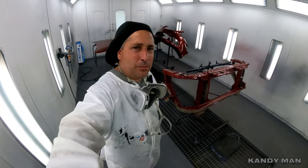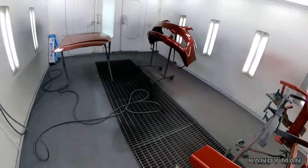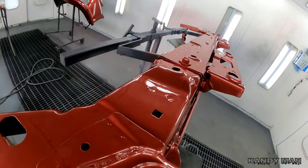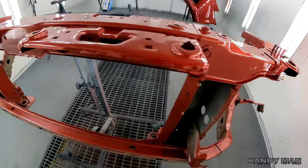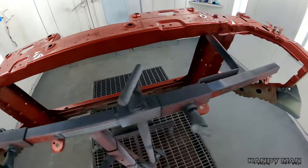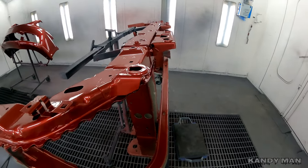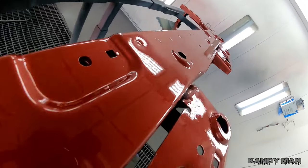All right, guys, so we went ahead and put a medium coat of clear on this, and you guys can see it's shiny. When we cleared those parts over there, we put one coat on this. Now you let this set up a little bit, and I'm gonna dust this now over this, even though it's shiny, and we'll get a nice matte finish from it. That way it's treated and it's got something on it, protection in case somebody uses a chemical on this to clean it later when they're working on this. You guys know how mechanics like to grab gas and wipe things down. So I'm gonna show you now as I dust it, and then I'll bring it back and show you how it's got a nicer satin finish, because you guys see there it's shiny.